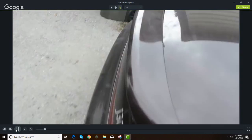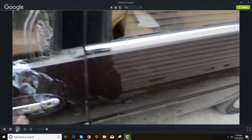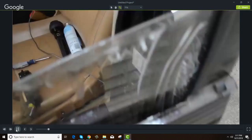I already got the driver's side open — that's just lithium grease. Got all the doors lubed down and the latch popped off on the inside because the clip was broken, so I've got to fix that, but it opens now. It wouldn't open at all before. This door now opens inside and outside.